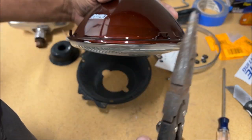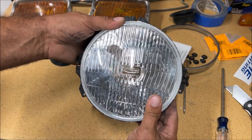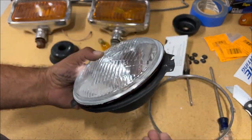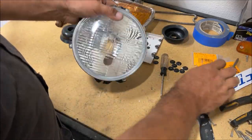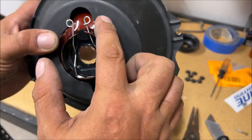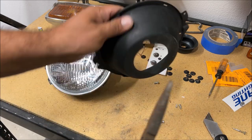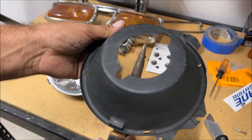I'm bending that tab down. At first it was sitting crooked; now we can rotate it a little bit — perfect. But it's still not even in there right, so you're going to have to play around with it. Now that it's modified, is the ring going to hold it in place? You can't have a loose headlight. It's loose — you've got to take it back out. If your headlight fits loose, you're going to need to either bend the tabs down a little bit or put some foam tape in there. That's all I did — now the headlight's snug.